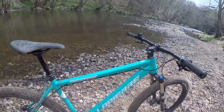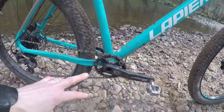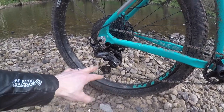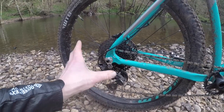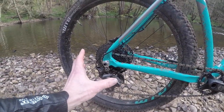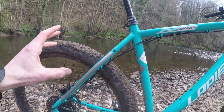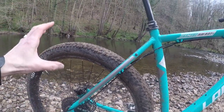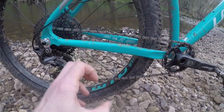In terms of spec, this is the top of the range bike so you're getting a LaPierre branded 1x chainset up front, XT rear mech — that's an obvious highlight — and an 11-speed Sunrace block. It's not mega range like an Eagle setup but certainly enough: 32 on the front, 11-42 on the back. The WTB Ranger tires in 2.8 aren't the grippiest but in terms of rolling speed they're really smooth, and with all that airspace on a proper big 40mm rim the bike properly floats along.